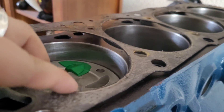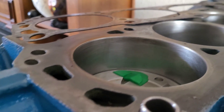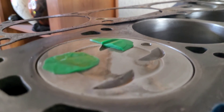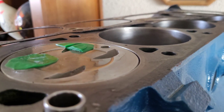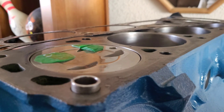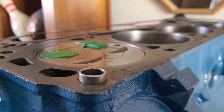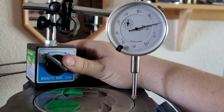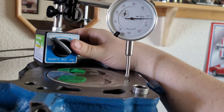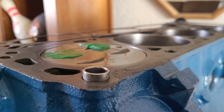Let me take this gasket off because I found something else out during this whole ordeal. Rotate the crank until the piston is all the way at the top. Stop - look at what we've got right here. The piston is damn near flush with the top of the deck. I used a dial indicator on that - it is sticking above the deck surface about two and a half thousandths. We're about three thousandths above the deck.